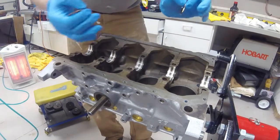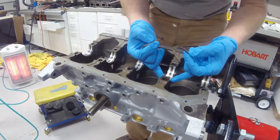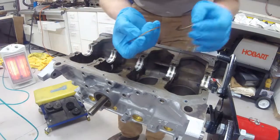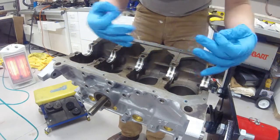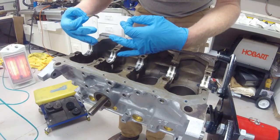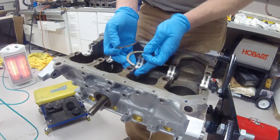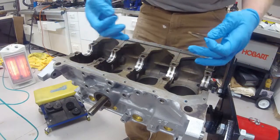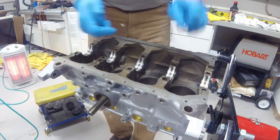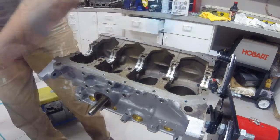Before installing the crankshaft, there's one last thing you need to do after your main bearings are installed — at least the first half of them. Thrust bearings. These go on either side of the number four cap area. What these do is limit the crankshaft's play forward and back in the motor. When there's thrust applied to the engine, the crankshaft will want to move one direction, and when thrust is released, it will want to move back. These limit that play so there's no damage and the crankshaft doesn't have too much forward-to-back movement. I've been using Permatex Ultra Slick assembly lube on the surface of these, as they need to be oiled for lubrication on the first startup.